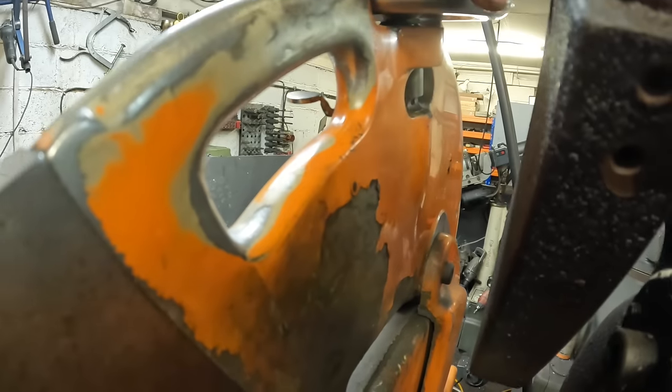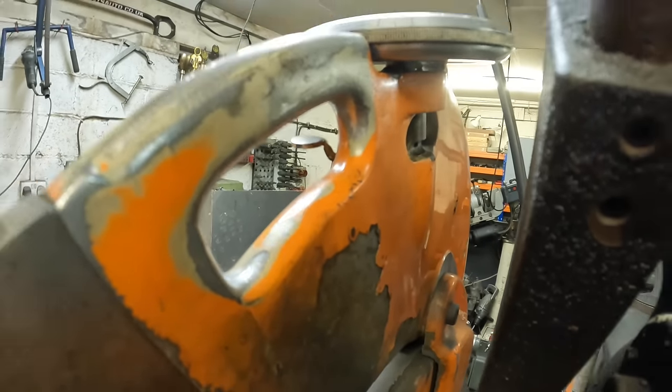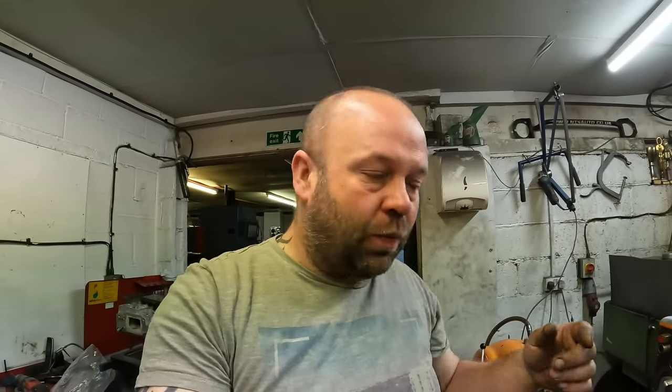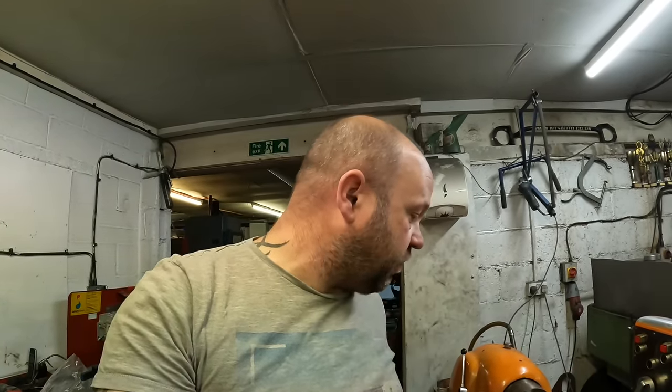there's a little window, and basically when I move that up and down there's like a little mark, and I want to set that roughly to the middle so I know that I can go backwards off the crank with the stone and forwards to cut off the stone. What can happen is that it could be set where it's only got, say, 5 thou of movement to cut in because somebody's wound the wheel and wound the wheel and wound the wheel. And what will happen is you just get halfway through grinding the crank because the first undersize is 10 thou, and then the machine will be hard against its stops, so you won't be able to grind the crank. So all these basic settings on the crank grinder are what's really important on grinding the crank.